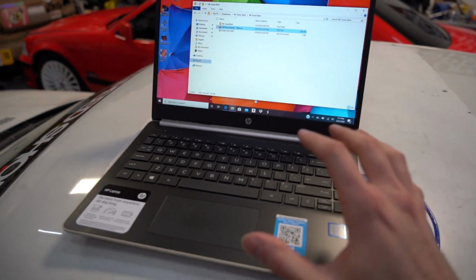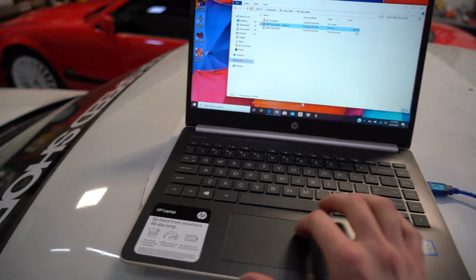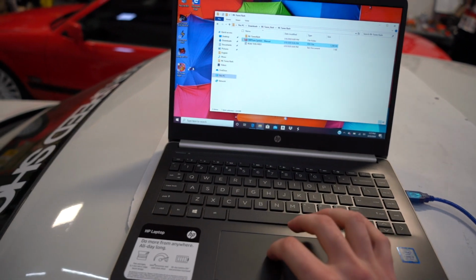So I went ahead and downloaded the file from my email to my computer. I'm gonna go and double check the instructions, that way we can upload it to the ECU correctly. Alrighty guys, I'm gonna walk you through this. I have not yet uploaded the new tune file to the ECU, but I just went over the instructions. I think I figured out what to do. So first thing, it is plugged into the OBD port. The key is currently off.